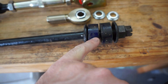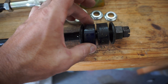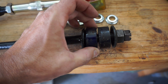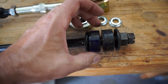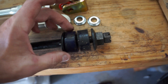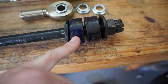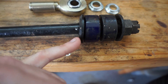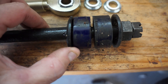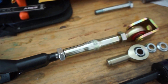I've gone through about three of these poly bushings already because they crack from the torsion or load on them - it splits the bushings. The rubber ones go out really quickly, but I've also had these poly ones fail on me. Now this poly bushing is holding up but the actual weld here is starting to get tweaked due to the pressure on the arm.